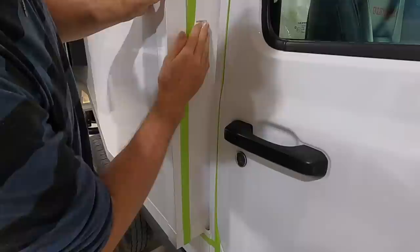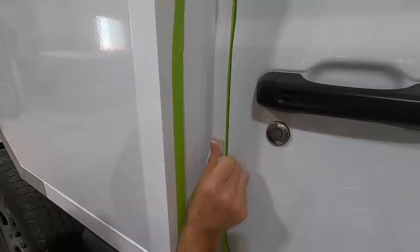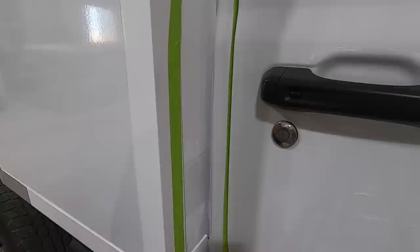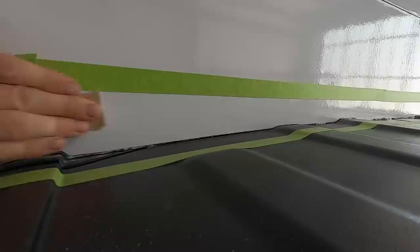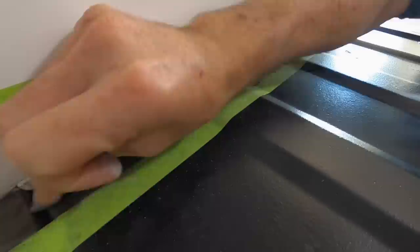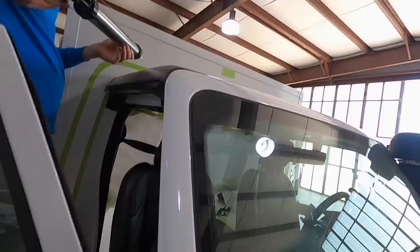It's time to do all the sanding and prep for another composite bond. We start with fairly fine sandpaper to knock the shine off all the surfaces, then use a very coarse sandpaper to scratch in deep so the glue will have something to grab onto. After that we wipe it down with alcohol and then the special primer. Right now I'm using sandpaper on the original Jeep paint — it feels pretty strange, especially scratching in really deep, but this will be entirely covered and nobody will ever see it. We do this same preparation on all bonded surfaces, including the front wall of the habitat and the top of the original Jeep Freedom panels.